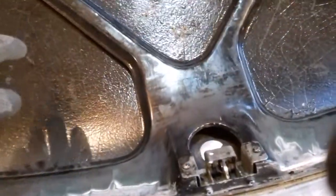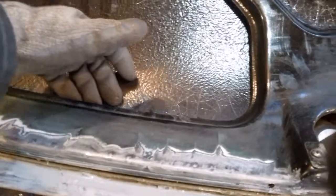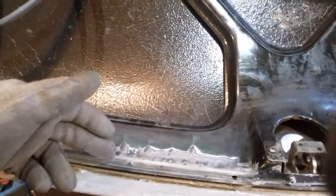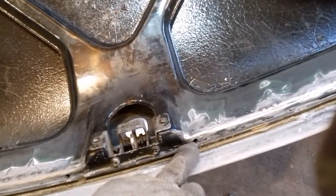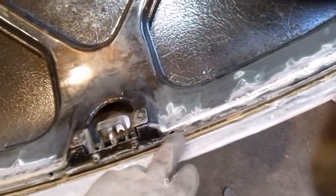It's not bad. Underneath here I've put some seam sealer in under that joint. Now you can see what the problem is with these boot lids — when the boot is in position, any condensation or water gets on here and runs straight down the back, ends up down here, and can't get out. So you've got like a trough of water in the bottom. I've drilled two drain holes in there, one each side of the lock. This is the lowest point, so any water that runs down here hopefully will come out through these two drain holes.